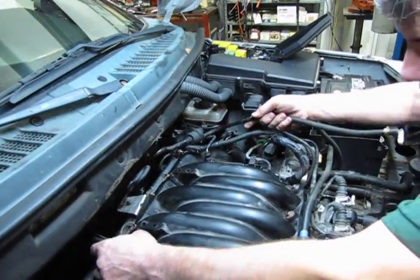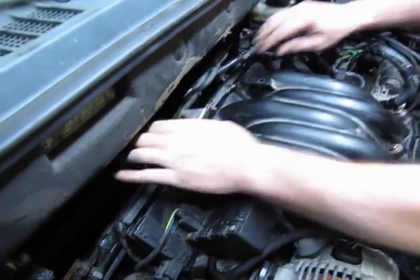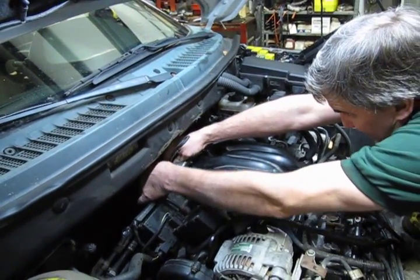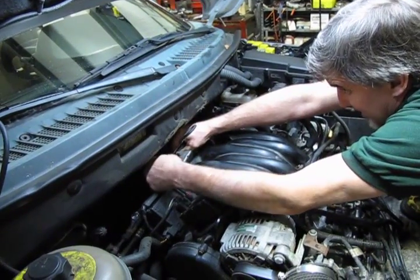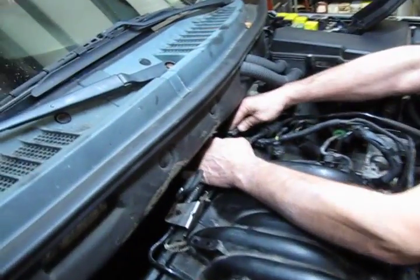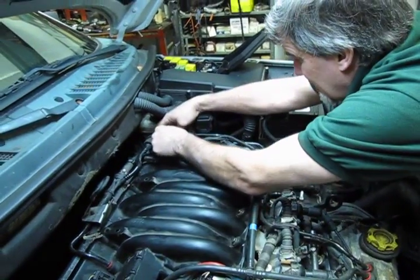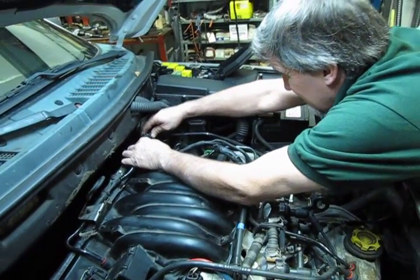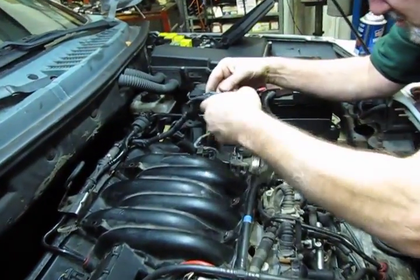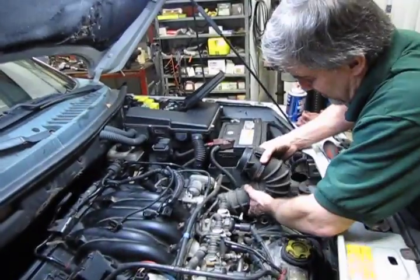That's going to go around the back. Plugs into the top of the intake. Don't forget you got basically a little mounting piece back here. Put that in. Listen for your click. And your wiring connection. And these we're going to wait until we put the boot back on before we connect the rest of the harness. Alright, so now we're going to slide the boot on.